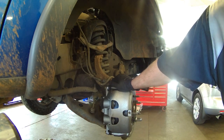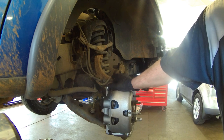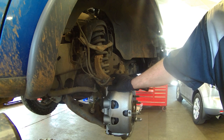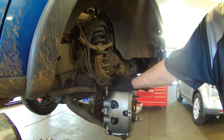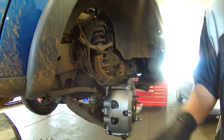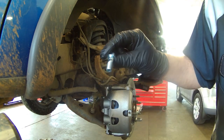If you just replaced your brakes, that would be it. We're doing the caliper, so we're going to transfer the hose over. If you're done, check the brake fluid level in the master cylinder. We've got two new washers and a new bolt for the caliper.